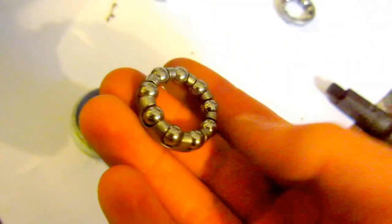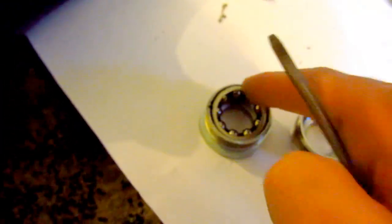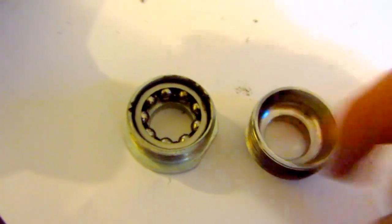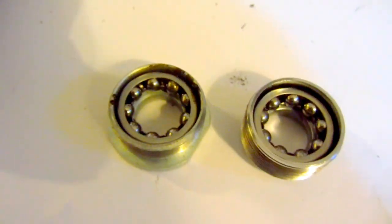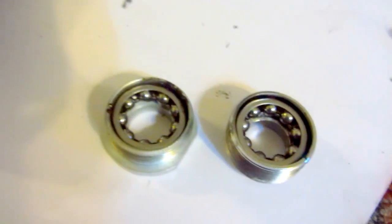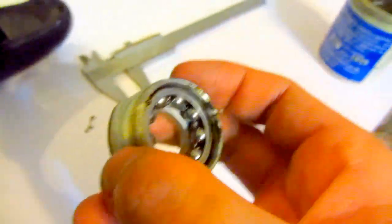Okay, and let's put some grease onto these spheres so that they can be inserted into these elements, something like that. And with the spheres down, so we don't insert it this way because the spheres won't touch the surface, so this is the correct way to insert it. Let's insert this one. This one comes here and we screw it in to the left.